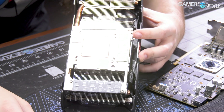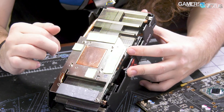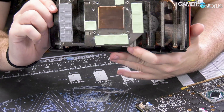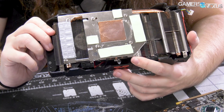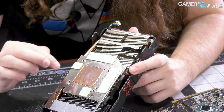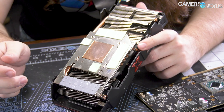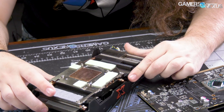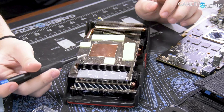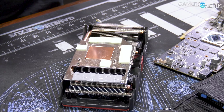The thermals are actually not bad on this thing based on our testing. Separately, the inductors are immediately below a fan anyway, so having direct contact is kind of irrelevant — it's got a fan blowing straight onto them and they can take 150°C. So that's the chamber for the inductors. We have an aluminum base plate for contact to the memory via thermal pad, and the VRM shares that same plate for the MOSFETs. Let's take this plate apart and see the rest of the assembly process.